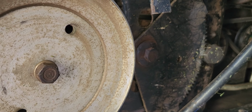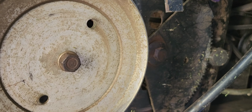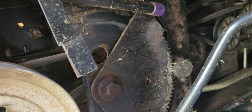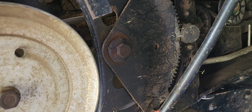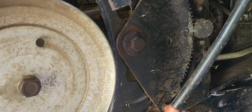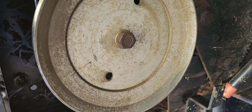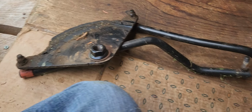clean the underside of both sides of that plate, and I think I'm going to put some lithium grease on there. Maybe make the steering a little easier. So that's just a matter of putting the impact on there and letting her come out. I don't think I can film this because it's so far under the tractor. But I'll do that and then show you taking the plate apart. It wasn't as easy as just taking that.